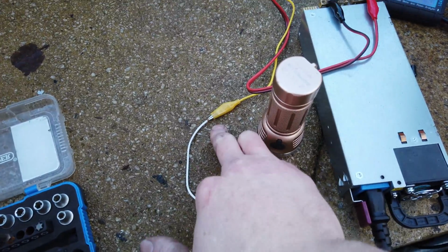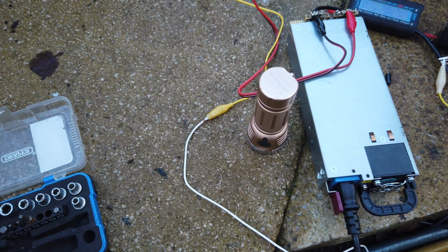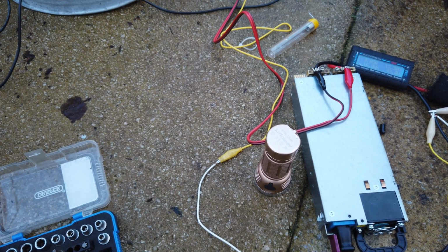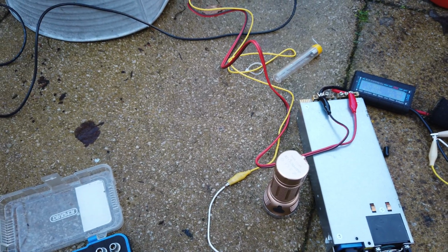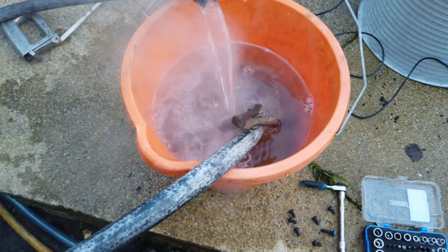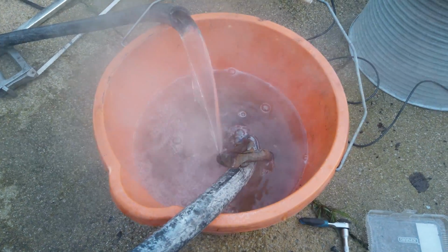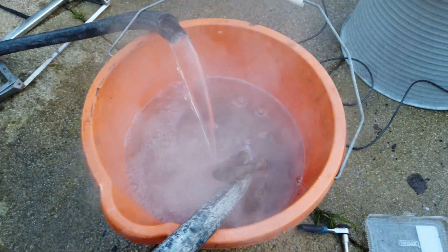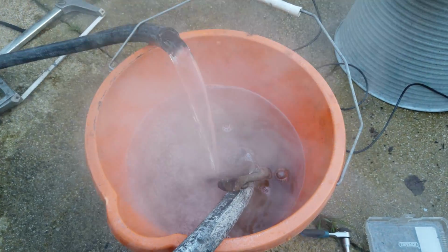And that there is the connection to the W bus line, so that's got the data going through it. If I unplug that, this heater will just stop, so it does need a constant link of data to keep it running. I just think people don't buy these because obviously you need a W bus protocol to start it up. It's not just as simple as shorting 2 wires out, for example, like some of the Thermo Top Z's or the C's.